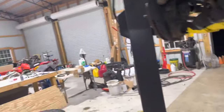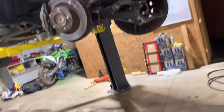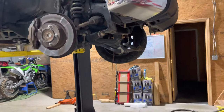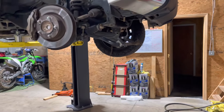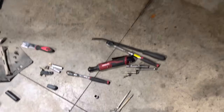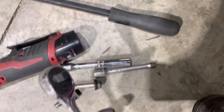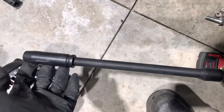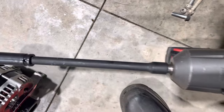Just a forewarning: I think the 4.7s are somewhat similar, but if you have a Tundra 2007 and up with the 5.7, know what you're getting into. These two bolts — the nut on the stud and this bolt — they're not easy to break loose. I had eight inches of extensions on there and it tweaked so much I couldn't get it. I put a three-quarter inch drive on there with a 14-inch impact driver. You'd probably have to use a half-inch bar coming out past the frame here to get those bolts back there out.